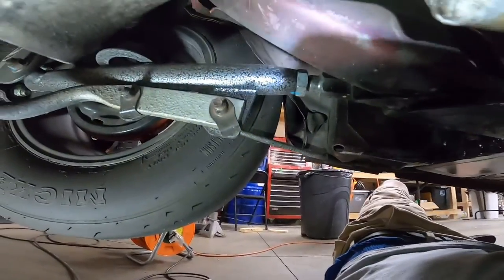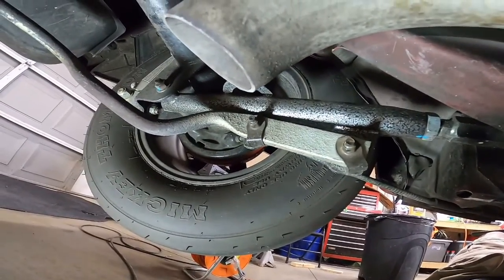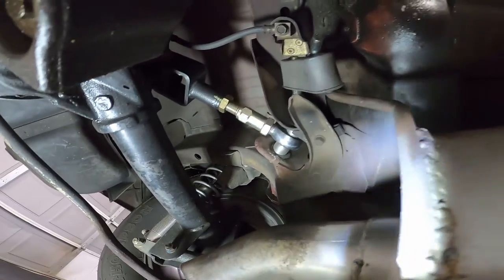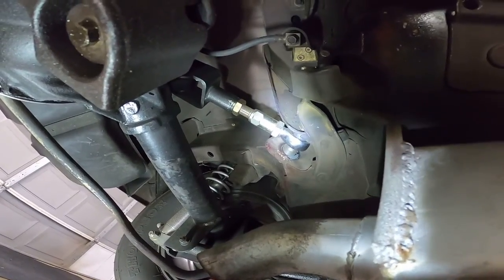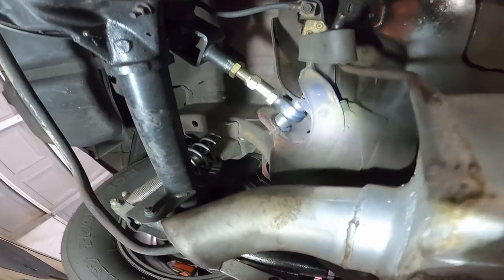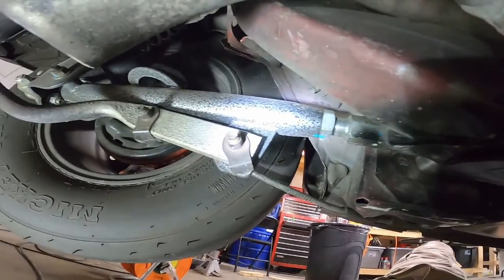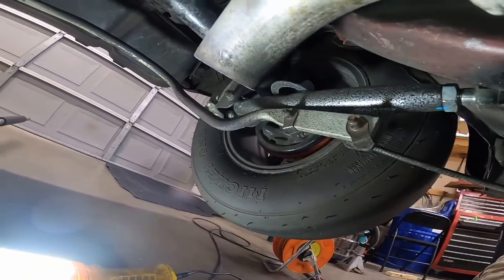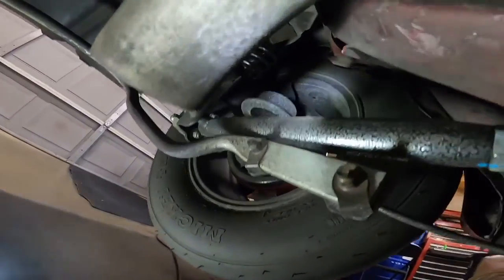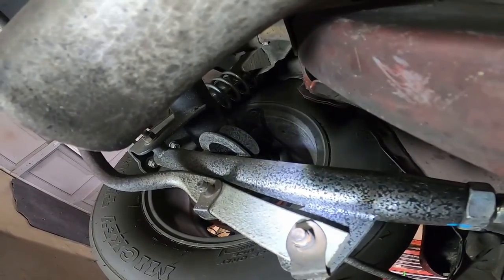our new lower and upper control arms in the car. Also made by Team Z. They're tubular construction with double adjustable joints on them. Put solid bushings in the top and the bottom, so they're all pretty solid mount. These still utilize the factory sway bar if you prefer to use them. They also have the mount for the spring perch if you're running factory suspension on the car.